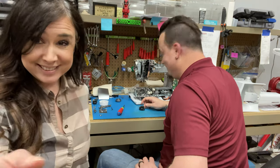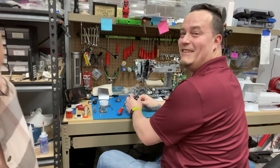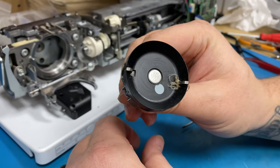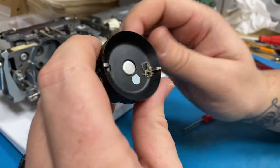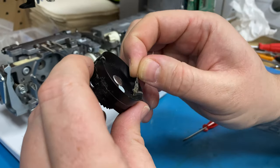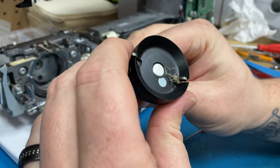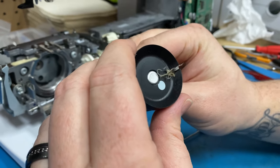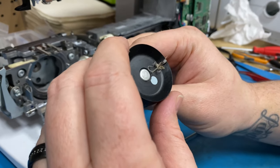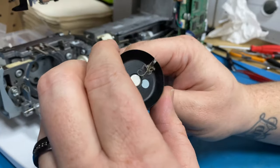We're going in. What are we looking at here? This is the hook driver of a 570. And as you can see, one of the fingers here that helps spin the hook has got some thread stuck around it. So what causes that? Well, extra thread — loose ends not being picked out. Some of the thread that's cut off gets dropped down there.